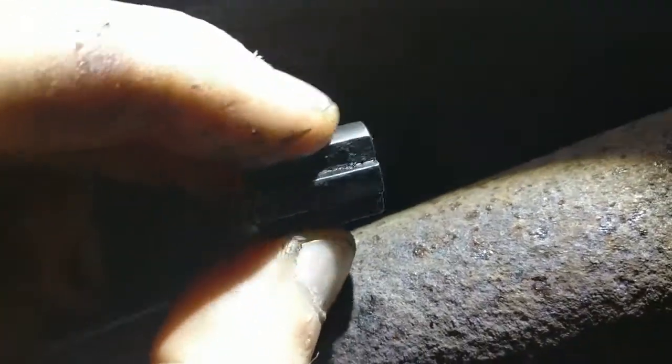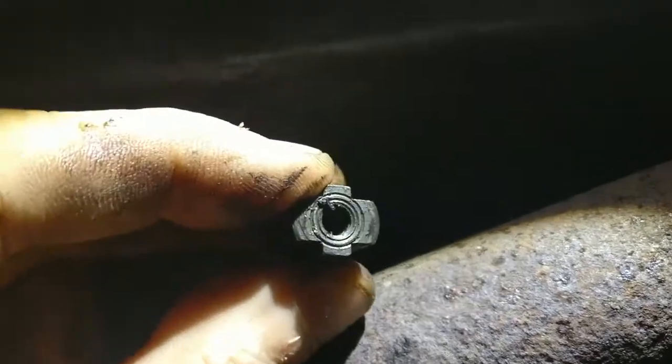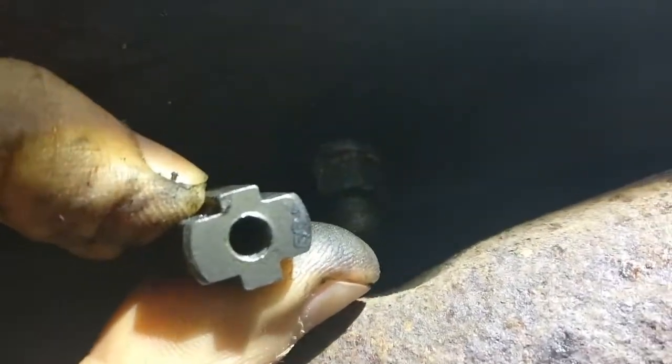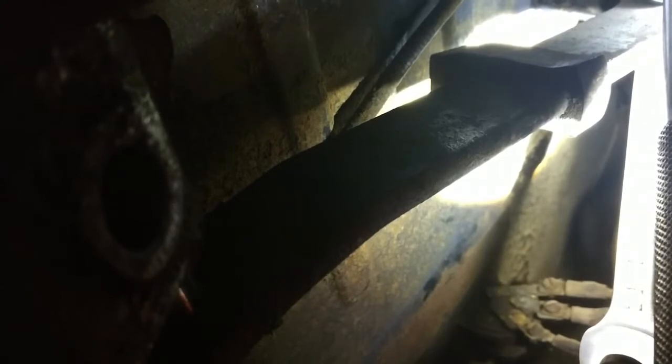And there she is. I would guess it would be insanely difficult to get one of these if you lose it, so put it somewhere safe. It looks like if we loosen everything off at the top there — which is basically just one bolt — the pedal will just come out of there. And hopefully the brake pedal will just slide out at that point, which will give me access to the master cylinder. There is still a brake pipe to release from the rear, but that seems pretty straightforward.